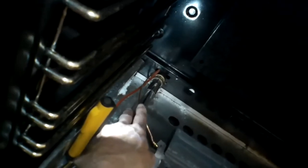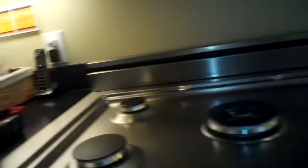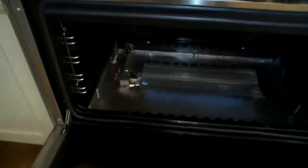Take your time and once you get this done your oven is going to work great again. If the thermocouple isn't making a good connection it'll keep triggering the safety valve and you'll keep losing your flame. This also applies to wall heaters — you sometimes need to change the thermocouple on those too. Now let's give it a test — push in and see if we get ignition. And there we go — a nice blue flame, back to normal. Thanks so much for watching, please subscribe when you get a chance!